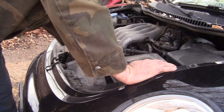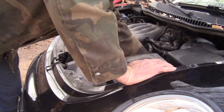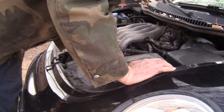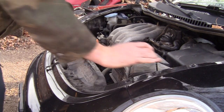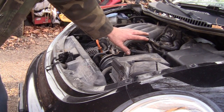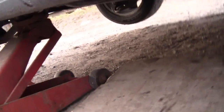The misfire could have been some dirt down there — I'm not sure. But this little hole keeps spotting off too. Seems to be some kind of crankcase ventilation doohickey. I'll check into this more. Let's get the fuel filter on it next, then I'll show you how to check the wires to see if they're leaking. The fuel filter is on the passenger side in front of the back wheel — there's the beast right there.